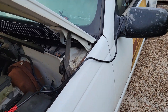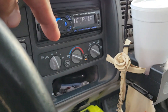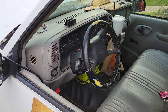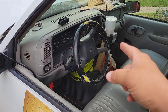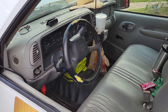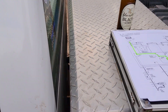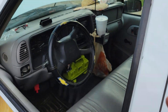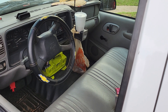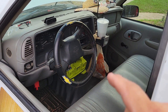My problem was I had the AC on, the light was on the button, but nothing was happening. Now, two years ago I had to replace that control unit, and those things are not cheap — a GM Genuine AC Delco is almost $200. What happened to my old one was I pushed the button, the light wouldn't come on, and I checked — there was power coming in, nothing going out, so I determined that the AC button itself had gone bad.